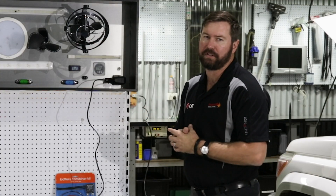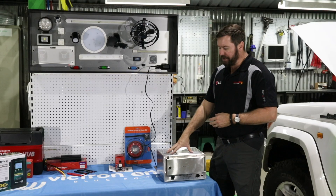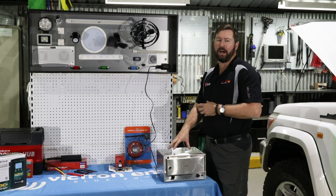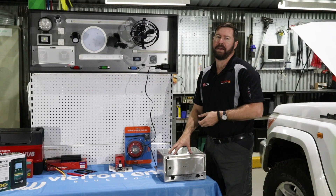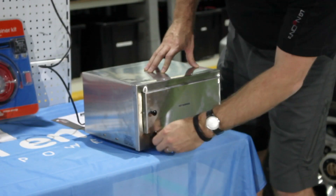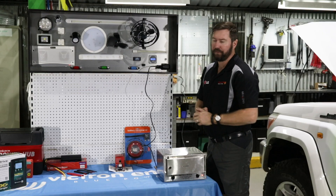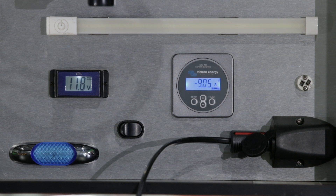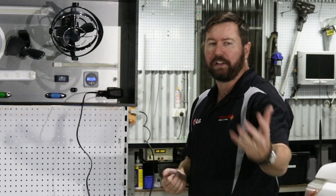Once we get past cooling, we look at heating. What can we run as a cooking load on our battery systems? For small systems, very little. Our batteries should be there to run our small appliances — any cooking or heating we want to do should be done on gas. This small 12-volt pie warmer draws 120 watts when running. If we try to cook a roast in it while stationary without a vehicle running, we're pulling 10 amps out of our battery every hour. Turning it on, we can see on our display it's drawing 9 amps and 110 watts — our battery won't sustain that for long periods. But this device is fine to run while driving — our dual battery system and alternator deliver the charge, and these will run perfectly for hours on the road.